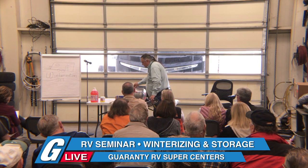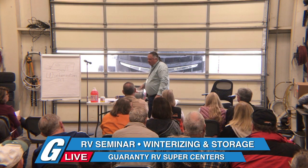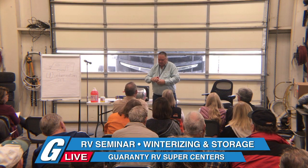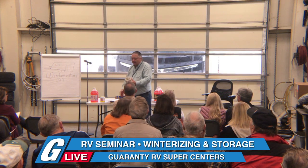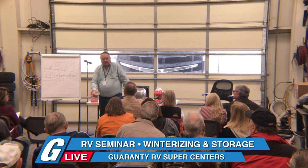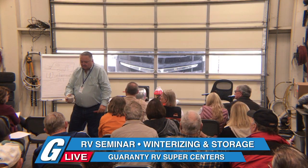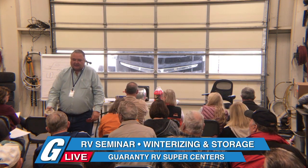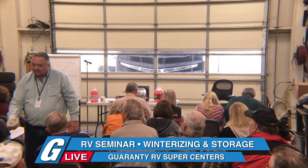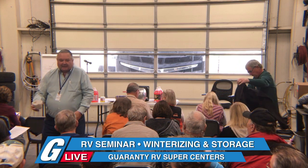If you've ever been here, folks, my mom's oatmeal. When you take that plug out, you don't stand right in front of it because it'll spray this garbage all over you. This is just a little bit of what we took out of one water heater. It's a hard water deposit that you have in your house, and it's in your water heater. This is a hard water mineral rock that ends up in the bottom of your water heater. It's just grit, sand. It looks just like sand because that's basically what it is.